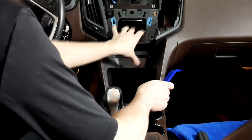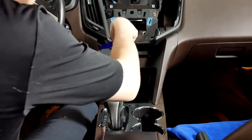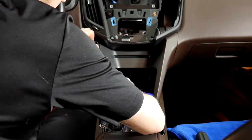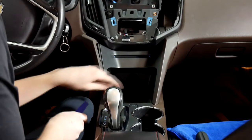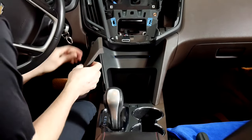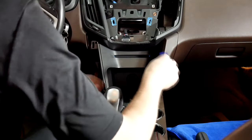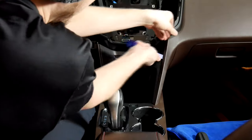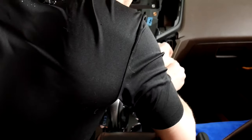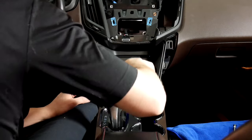From here we're going to take this out because our radio is back behind here. First thing we need to take off is these two little side pieces. Take your pry tool — if you go for the top first it makes it a little bit easier. Work your way down; as you get to the bottom it's a little more difficult as the corners fit in right here, so you want to lift up as you're pulling. It'll come out like that — you'll see it's just three clips. Same on this side. Now we've got those two out, you can pull out this little rubber piece right here as well.